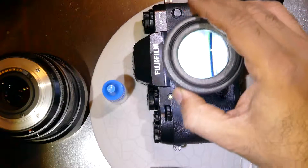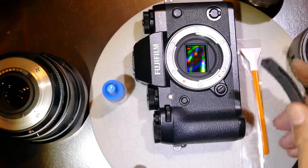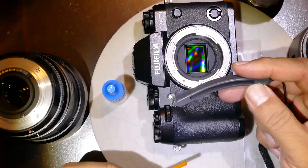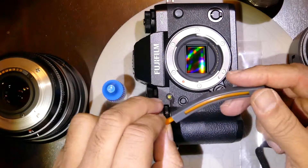So let's do an inspection first to locate the stains on the sensor. I highly recommend getting a curved swab — you can do it without one, but a curved swab is highly recommended to produce the optimal angle for swabbing.